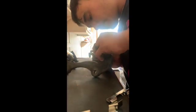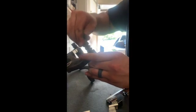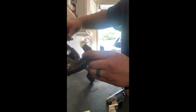That's it. Make sure everything clears good. Nothing's gonna hit your rotor. Take the other one out, put that guy in here. Again, just make sure everything sits properly, nice and flat. Nothing's gonna hit the rotor. Boom, bam. Make sure these guys aren't seized up at all. I usually don't take these out and lube them if they're already looking good. Make sure the boots are all good, not cut, not getting rusty. Okay, all right, sounds good. I'll do it to the other side and start putting these back together.